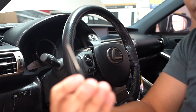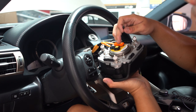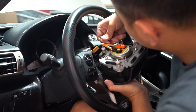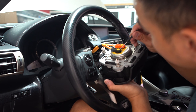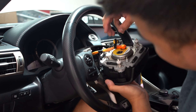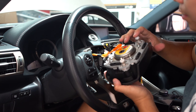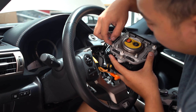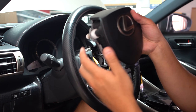Now that we've got the airbag cover out, we need to get the airbag out completely. You'll need a small precision flathead to remove the yellow clips on top of the connectors — they just pop up vertically. There's also a ground here that can be released with a push-release pin, and your airbag is out.